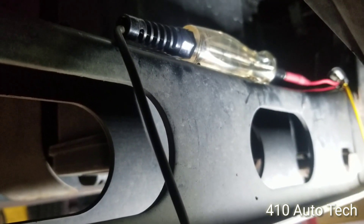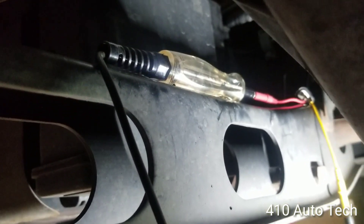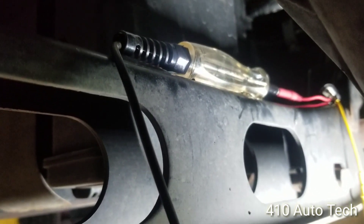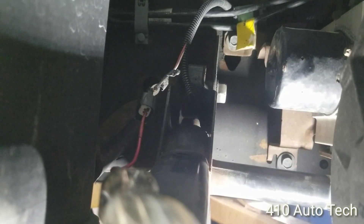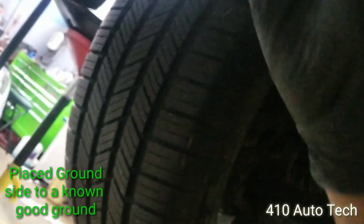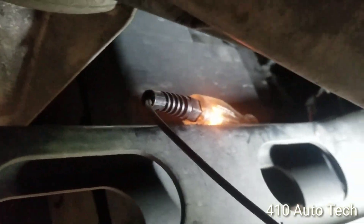I have a test light in between. Command it on — it's on, it's on. No light comes on. Back off — no light. So now we're going to check whether we have power or ground missing. I have the terminal in — power side on the corner is a good source ground up here on the chassis. Command that ground on the scanner already on, and when you look at that, we have good power.